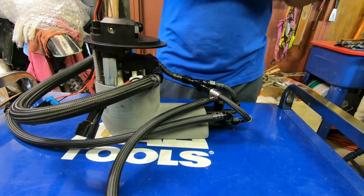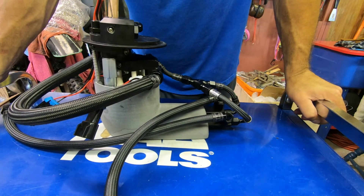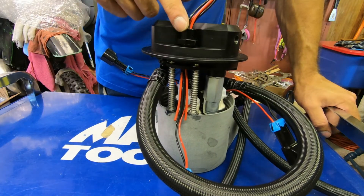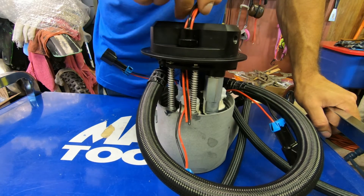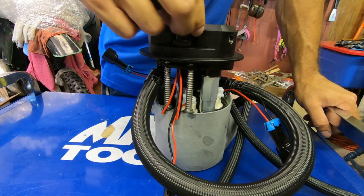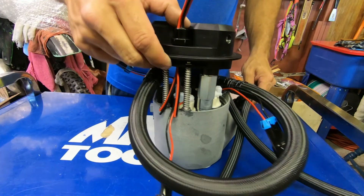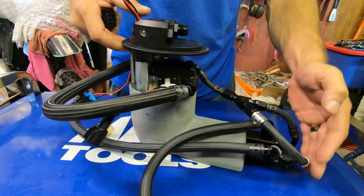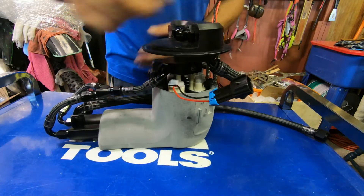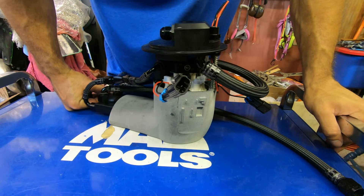I totally forgot to talk about electrical — go figure, mechanical guy leaves electrical out. We're using the same kind of pass-through as the other ALM hats. It's an SAE port. I just have one stuck in here to show concept. We'd have six wires for a V to feed the three pumps, or eight wires for anything on the Zeta platform. This is configured for CTS-V Gen 2. This bucket uses the OEM level sensor from the CTS-V, which hooks right in here.